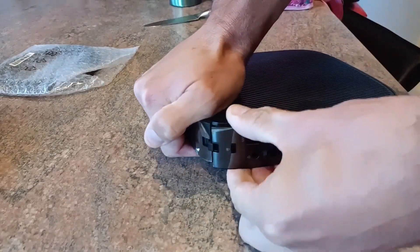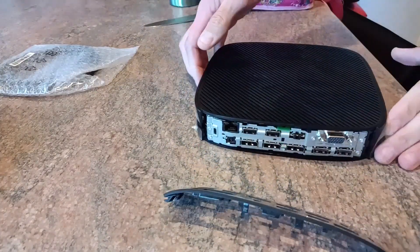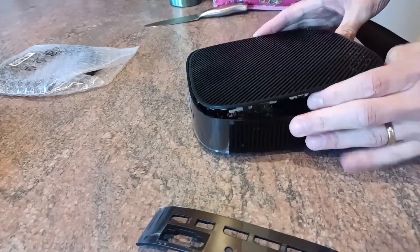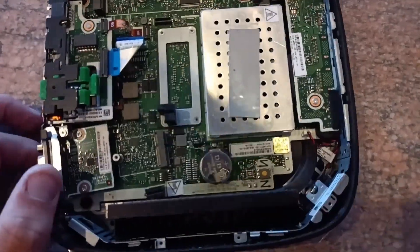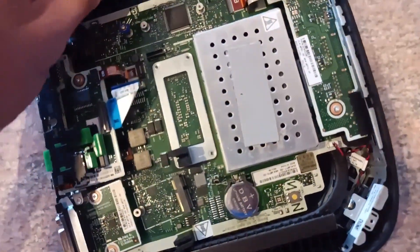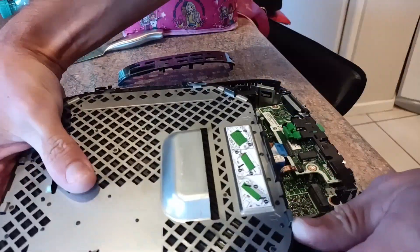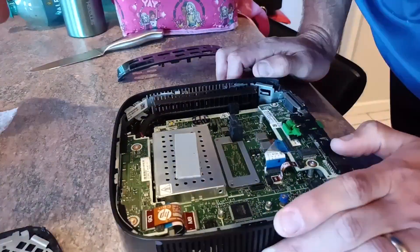Getting into this one is a little bit more tricky, but the back panel snaps off and there's a green tab to remove the lid, which eventually comes off. Inside it's a lot more cramped, and it took me quite some time to figure out where the RAM is to upgrade. The processor is clearly not on this side — we've got a daughter board at the top for all the front I/O. I stared at it for quite some time before studying the lid, which has clear instructions that the RAM is under the metal shield.